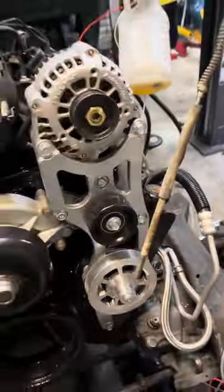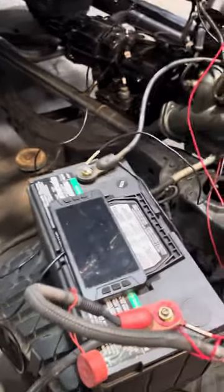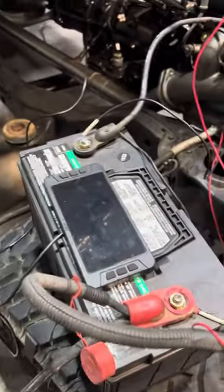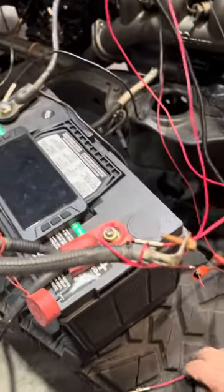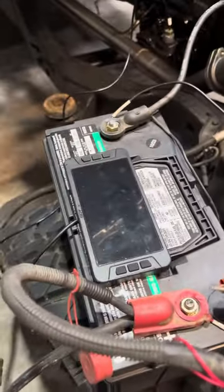You've got that orange wire that goes to your fuel pump — you'll need to ground your fuel pump to something. All this is temporary, obviously. You have a main power wire in your harness, a main ground wire in your harness, a CAN wire that hooks to your little screen there, and an ignition wire. So you can go ahead and turn the ignition on.